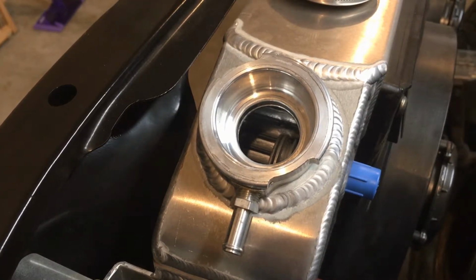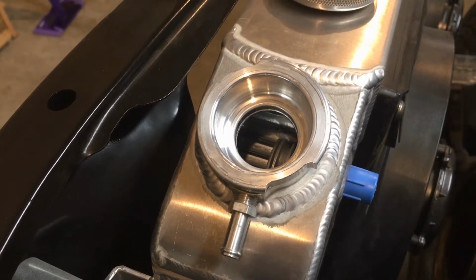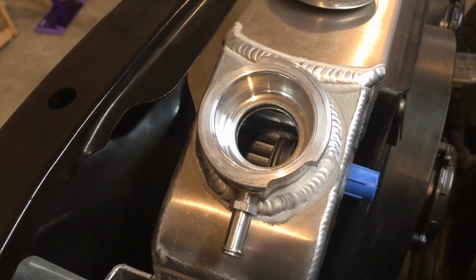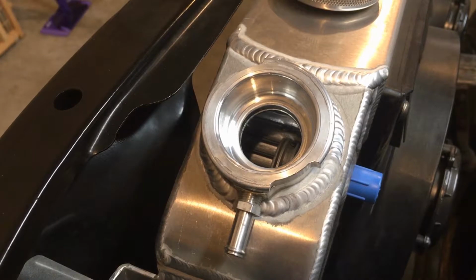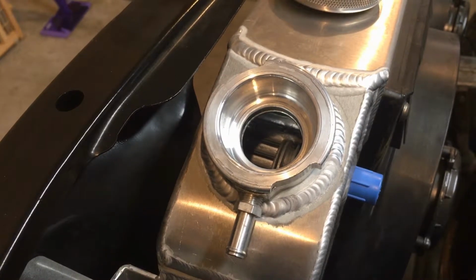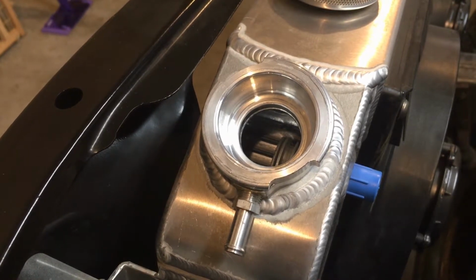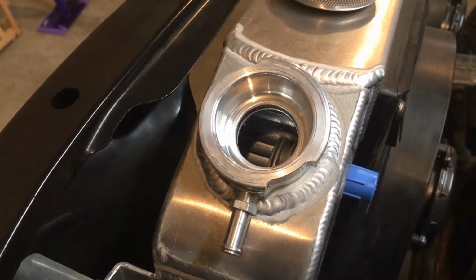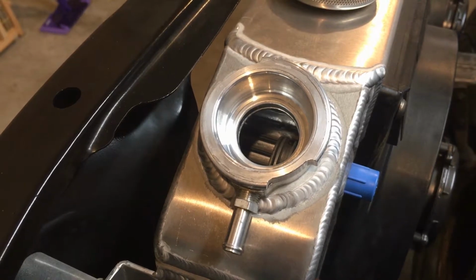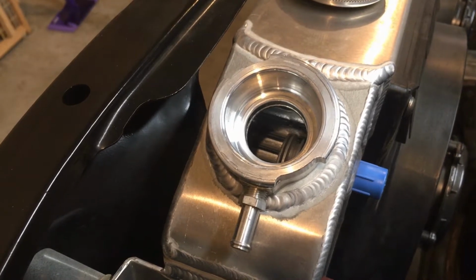A lot of the old ways of looking at a radiator is it's a 2-core or a 4-core, and obviously everybody wants the bigger 4-core radiator for higher horsepower and bigger heat motors, big blocks, whatever. This is a 2-core radiator, and it's enough to probably take care of probably 1,200 horsepower on this engine, which generates a lot of heat, especially since this one's going to be a turbocharged application. The old school way of looking at things with 4-core and all that kind of doesn't really mean anything anymore.